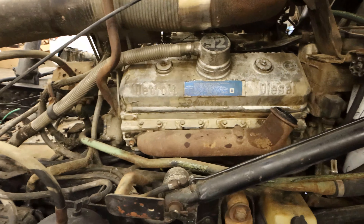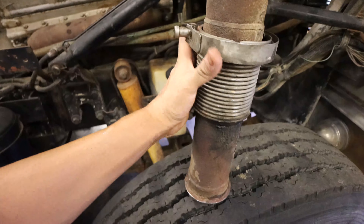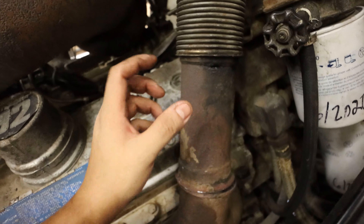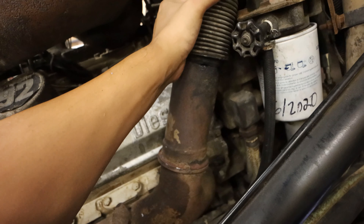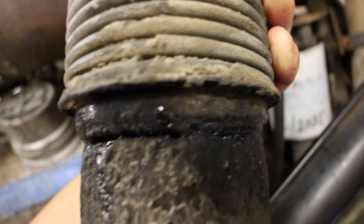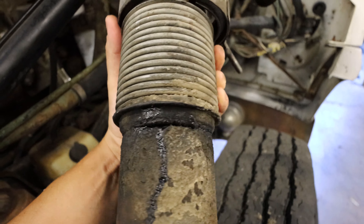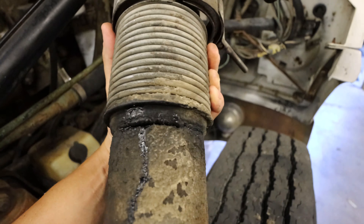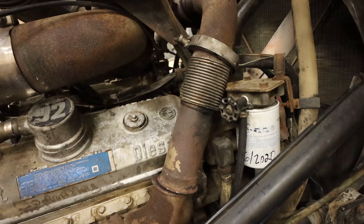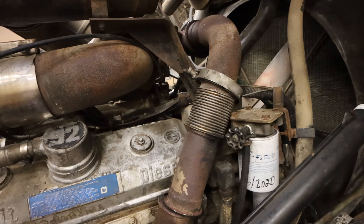So I thought I was done filming. Got the cover back on, everything ready to go. There's this exhaust crossover pipe that goes right to the turbo. I've noticed since I've had the truck there was a little pinhole right here with a bit of exhaust coming out — I kept thinking no big deal, I'll fix it eventually. But when I went to put this back on, the whole thing is busted — it's cracked almost a third of the way around the pipe. So I'm going to leave it off, clean it up, throw a quick weld on it probably tomorrow, and then remount it. You never know what's hiding behind a pipe. I've seen these for sale pretty cheap, but I'll try to fix this one and run it for a while.